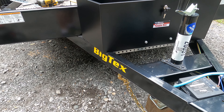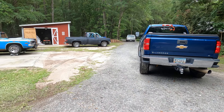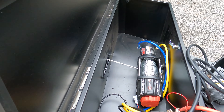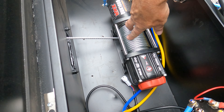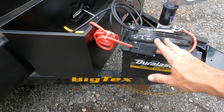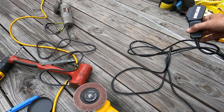The angle iron is now across under the box, hooked into the frame at all four mounting points. We've got our rough hole cut — I'll file the edges and hit it with some paint, then mount the fairlead on the outside. My help went inside, but that's fine. We went ahead and put primer and black paint on there. The winch is mounted nice and solid. The wiring harness looks scary but it's super easy — everything is color coded: blue, black, yellow, red. I'll route these so they can't get caught in the cable and mount the controller on the side. I'm not storing a battery in here; I'll always use an external battery, so I'll keep the cables long. It also comes with a 10-foot control cable.